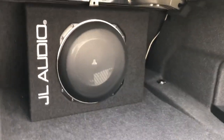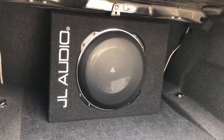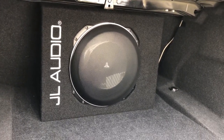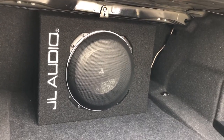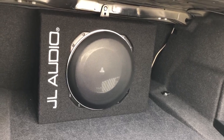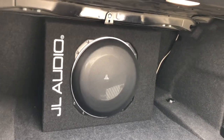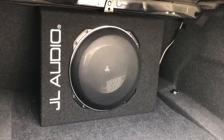Yes, you lose some of the punch from the subwoofer, but we're not trying to get any punch from this subwoofer. This subwoofer is actually running from 60 Hz down. The subs under the seats are running from 40 Hz up, so there's a little bit of a crossover there - which is why time aligning on the subwoofer is crucial. Getting the phase right with the subs under the seats is more important than you can possibly imagine. That subwoofer is literally just producing the real lows.